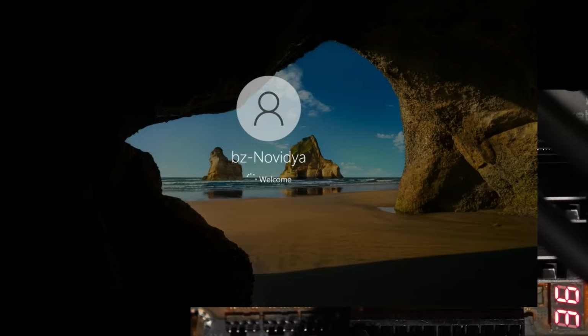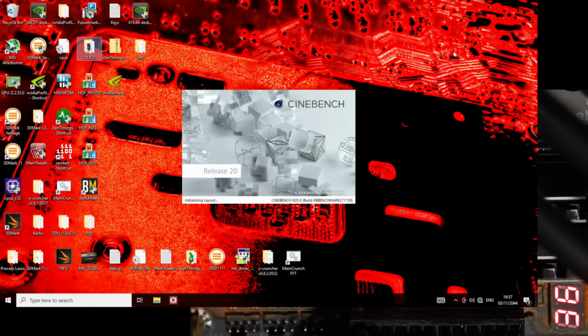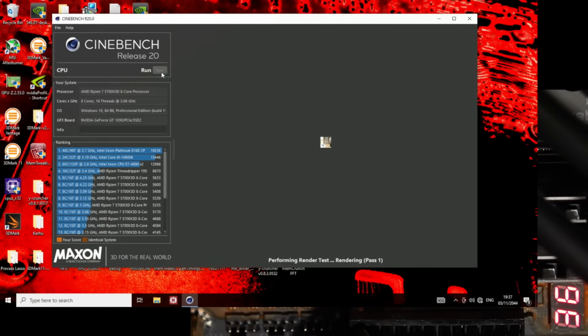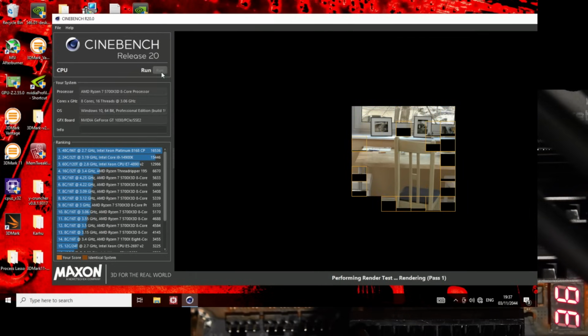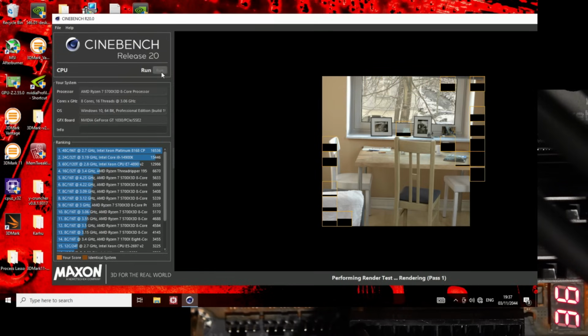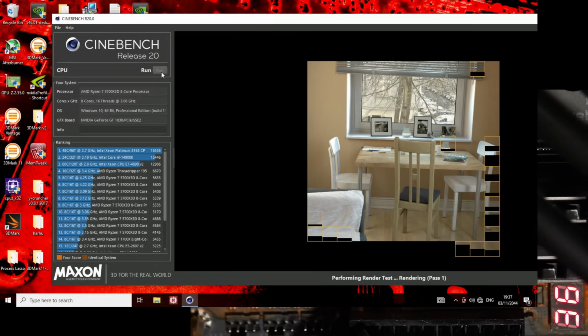That's the nice thing about Cinebench: you can literally use that score as basically a frequency indicator, because it really doesn't care about anything other than core clock, especially on Ryzen CPUs. Some earlier, DDR3-era CPUs, Cinebench would potentially be somewhat affected by memory settings. Oh, and like X299. So there are exceptions, but on the Ryzen 5000 series, Cinebench R20 is a core clock test. So yeah, let's see what happens at minus 100. On full auto, the CPU does 5339. At 102 BCLK it does like 5392, right? And at 103, it might do like 5400-ish.